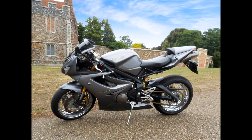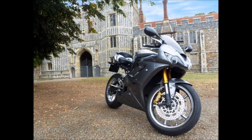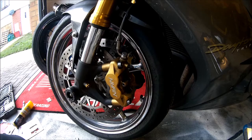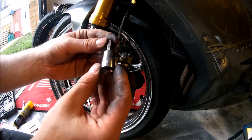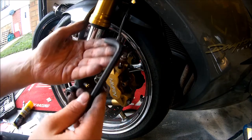Within this video, I'm going to be showing you how to replace the brake pads on a Triumph Daytona 675 front brakes, which are the Nissin Calipers. The bike that I'll be working on is a 2006 model, however, I believe the braking system runs across most of the models. First off, you will need an 8mm Allen key. This can be a socket like this, or an actual Allen key, up to you.